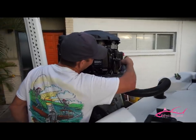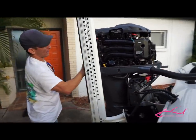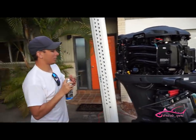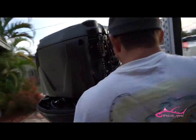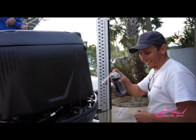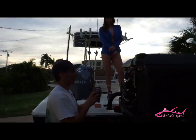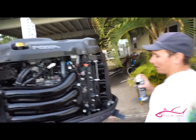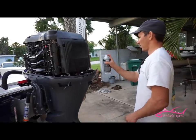What's it called, Jamie? Yama Shield. It fights corrosion. Do you do a whole bottle of it? No — I just spray down a light coat over the whole engine, underneath the cowling obviously. And what is it good for? It helps prevent corrosion, so you don't get corrosion on these things — because you get water, and it's salt water. I think we're good — I'll just put a little light coat on here. All nice.